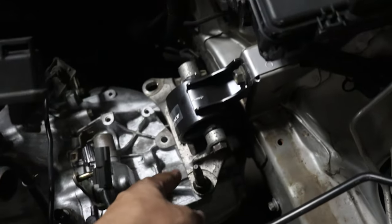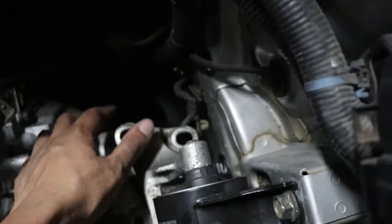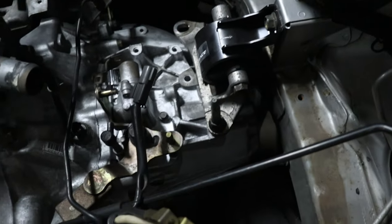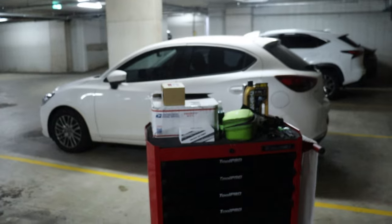As you can see, only this one, right? This is a gearbox mount. This is DC5 side, this is Accord side. This bracket is Accord. Look, the two holes are just open, like only one lined up, because it's very similar to K-Series. The K-Series boxes are similar, but the housing of this one is different, which is why I needed those American mounts there. So I do have those mounts now.